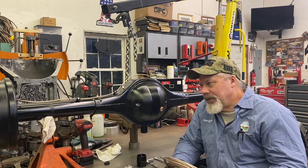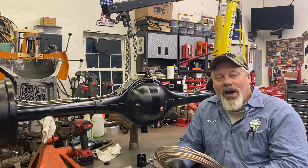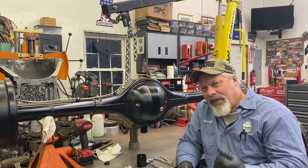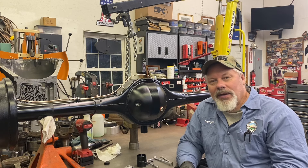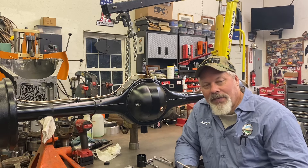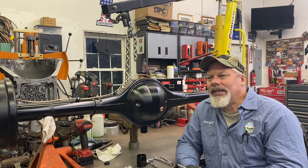Now I personally prefer — let's talk about some details. This is nickel copper line. It looks like copper line but it's not. It's stronger than just copper line; you can't use plain copper for brakes. But this is definitely flexible and easy to work with. I actually prefer steel line for hot rod work — it's probably not going to see salt. They make coated steel lines but it's much harder to work with. I grew up working on steel lines with my Snap-on flaring tool. But now my Snap-on flaring tool lives in the box because I have a better rig, which we're going to use in a minute. Tonight I had enough nickel copper on top of the pile, so that's what I'm using.